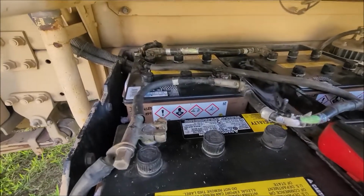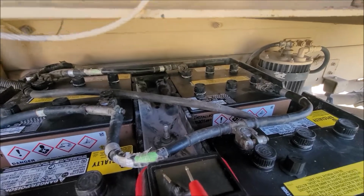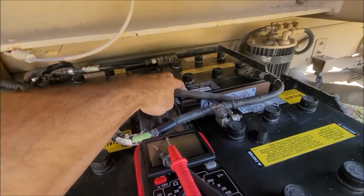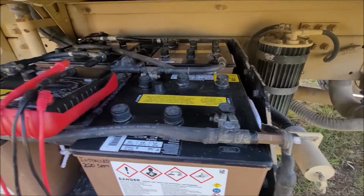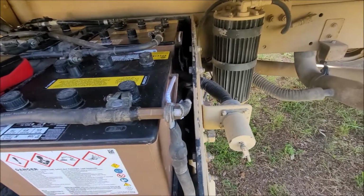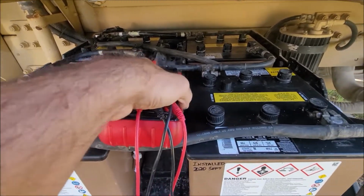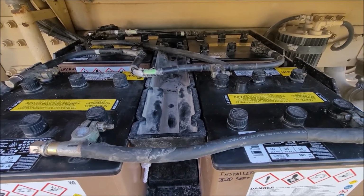All right, I finally get everything in. That back battery terminal was supposed to have had one of these and it was broke off, so I had to stretch the slave positive connection over there and just got it to reach. Everything was all kind of jacked up in here. Took my multimeter and tested on here, getting almost 26 volts, so everything's hooked up right. After fighting me, the modification of the bracket worked. You can see how it's sitting in there flush now.